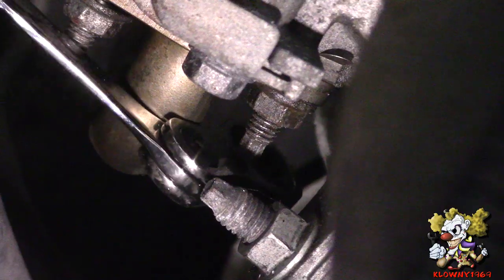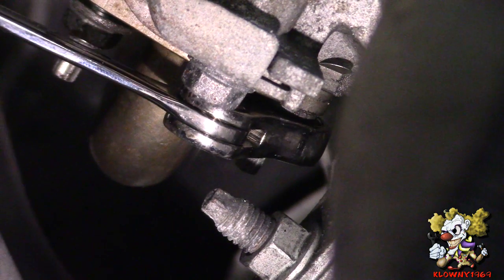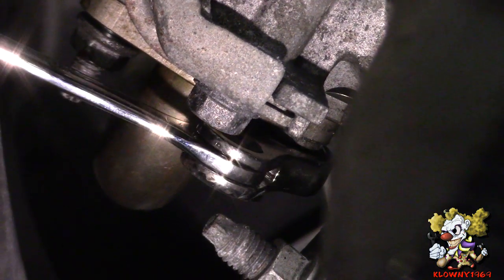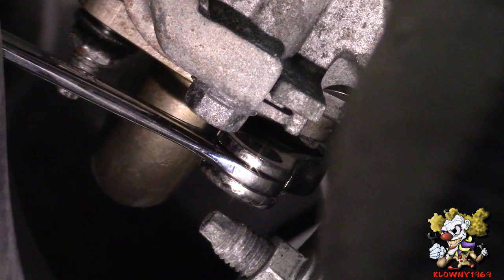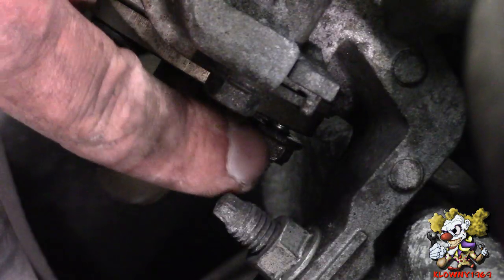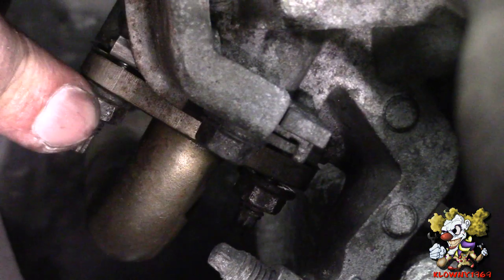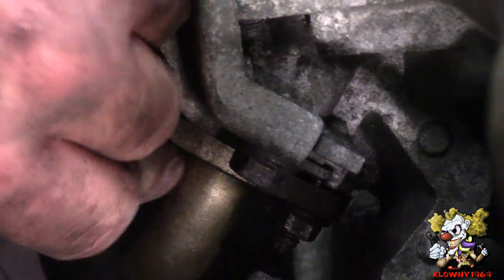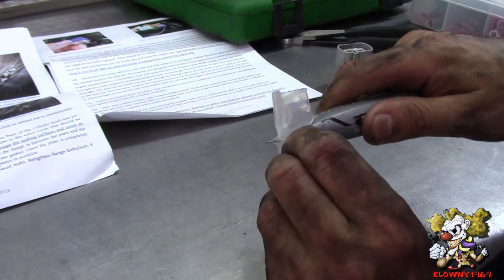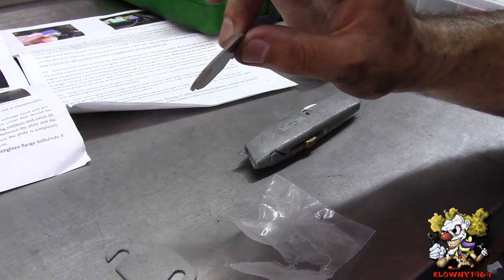Let's crack the other side too. This side — try to put a wrench on it. This is loose, as you can see. I can turn that by hand too, and this is also loose, so thread it out — not all the way out. These are the plates they give you, and they're slotted so you can just insert them down, make a little space, insert them down, and tighten it back down.